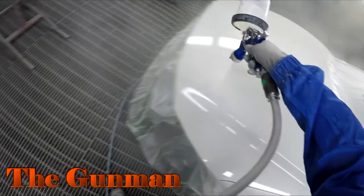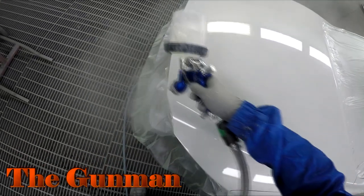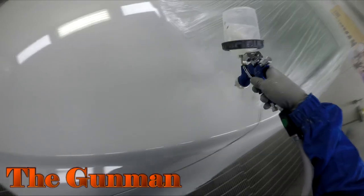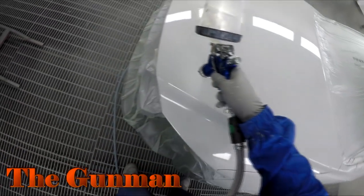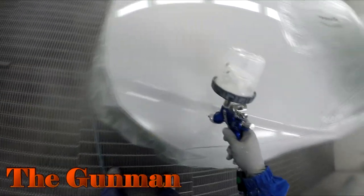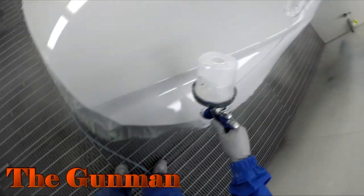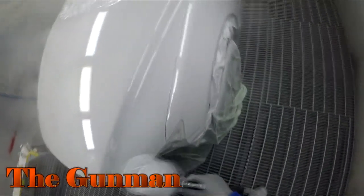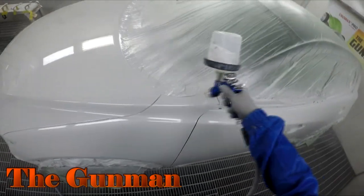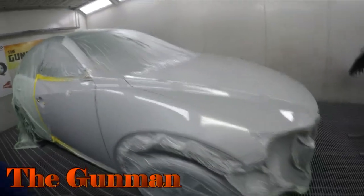You've probably noticed I'm using the DeVilbiss Boost GTI Pro Light 1.3mm with their T110 air cap on it. I really love this gun and air cap. The reason I chose the T110 is because it's a Mazda — I usually use the TE20 for a standard everyday refinishing job, but the T110 has a finer atomisation and it's going to replicate that Mazda finish a little bit easier. Even the apprentice came in and had a look at this job — first or second year apprentice — and said you did a real good job matching the factory orange peel and factory finish of that Mazda. I'm happy with it.